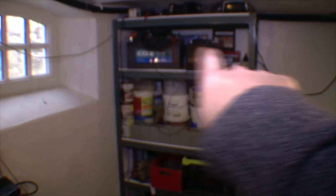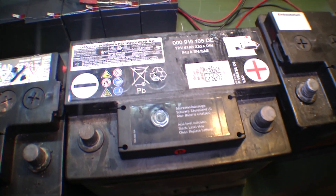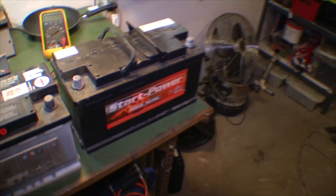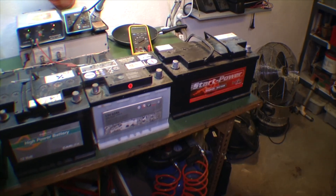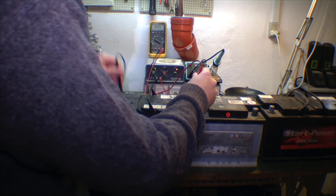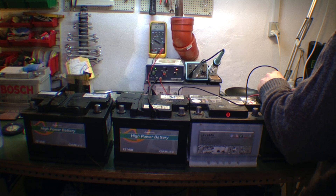Now they're down here. I have to move some of the other batteries around - I want a couple of them to be charging. But I want to check the water in these first. I deliberately got some with water in them, because ones with the caps on them are a bit harder to maintain when they're not really meant for maintaining - I prefer ones with distilled water. I went and bought some distilled water to top them off if anything is missing. Let's start with a voltage reading: first one is 11.3, second one is 12.1 or 12.2.